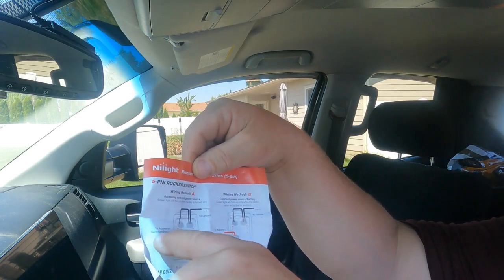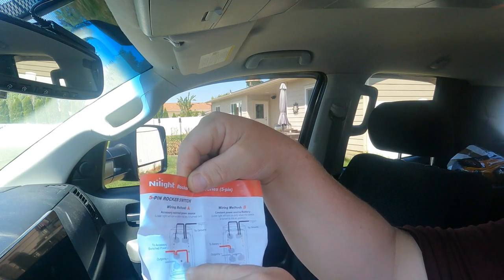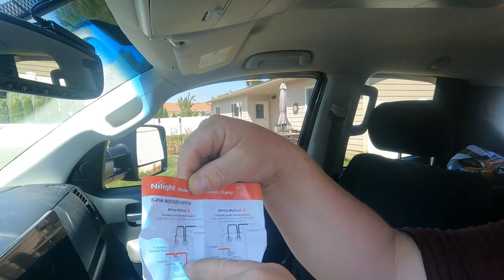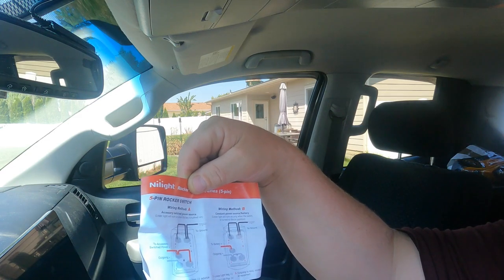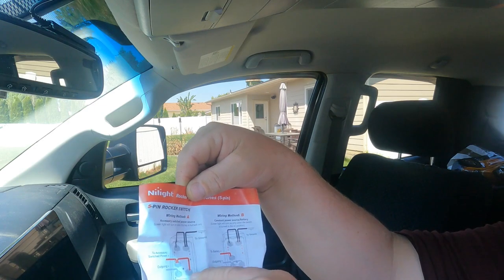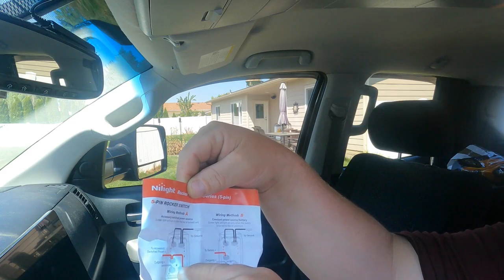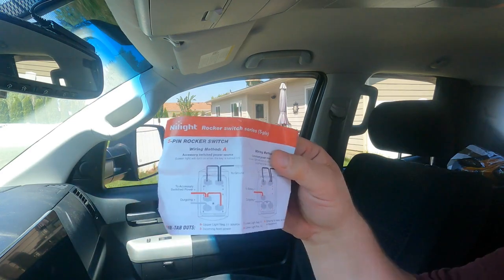Since I'm bringing this in from the battery, if I was to jump this over, that lower light would be on all the time. So I'm actually gonna come off the headlight switch to a relay and fire power on that only when the parking and headlights is on, okay? Are you guys following? I think you are, you're a smart crowd.